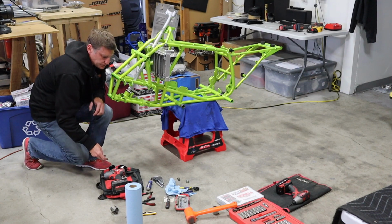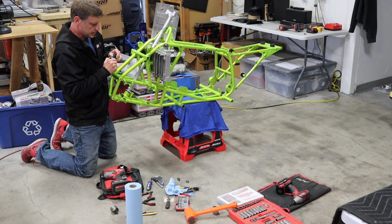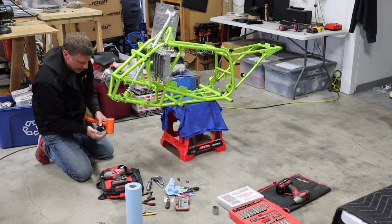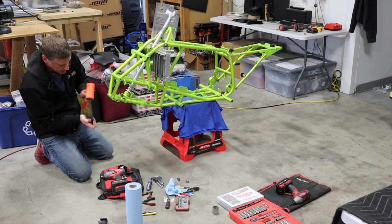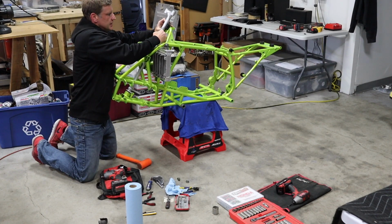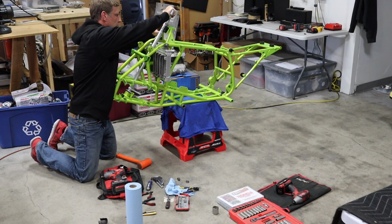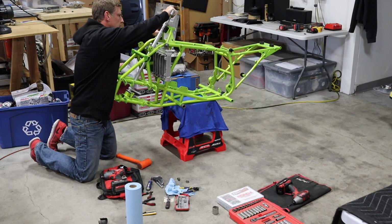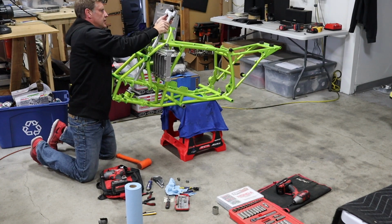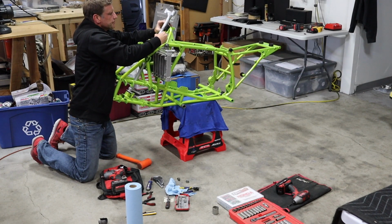The other thing you'll find with a new stem is if it's powder coated, a lot of times you're going to have an issue with it being super tight until that powder wears down. So there's not much you can really do about it. It's just one of those things that you can loosen the bolts a little bit. Obviously not enough where it's going to be an issue, but you can loosen the bolts. See, I can kind of feel, I'm wondering if I should use the other one just because, well, let me bolt it up. Let's see, I can always swap it later.